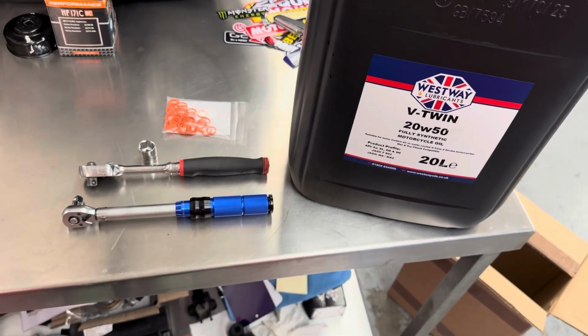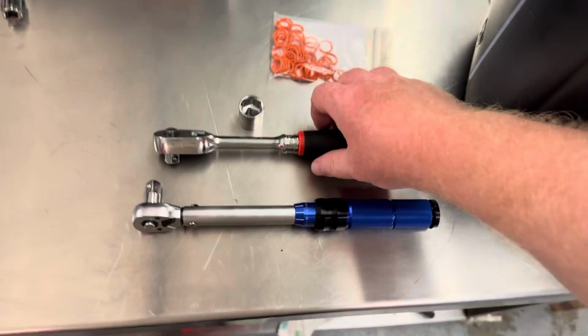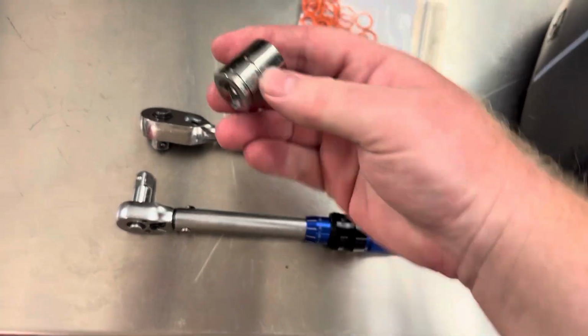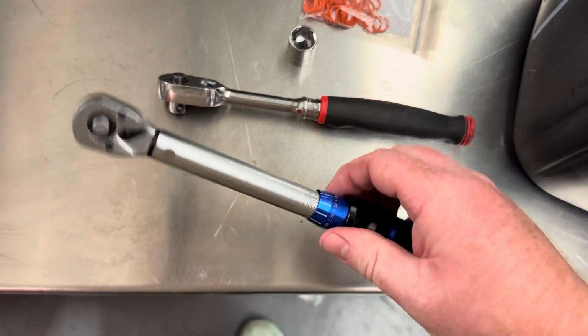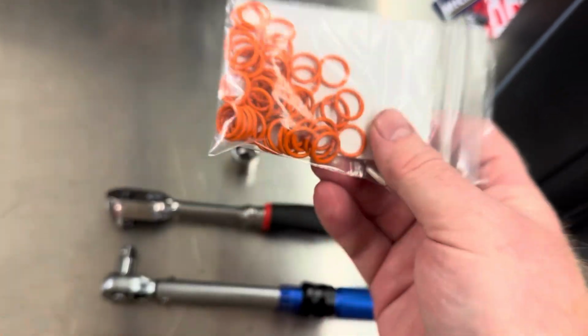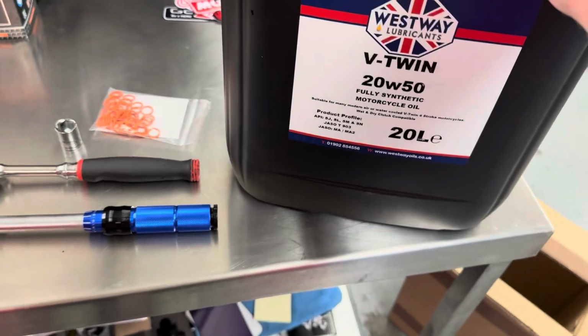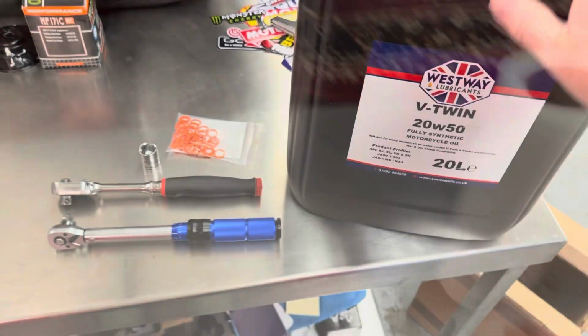Parts you're going to need to complete the oil change for the gearbox is a 3/8 ratchet, a 16mm socket, a little torque ratchet so you can tighten things up. Definitely use new O-rings. They're linked in the description below, and some 20W50 motorcycle oil.